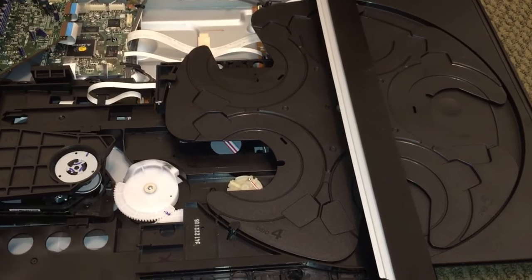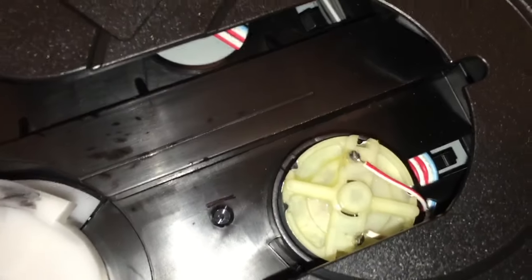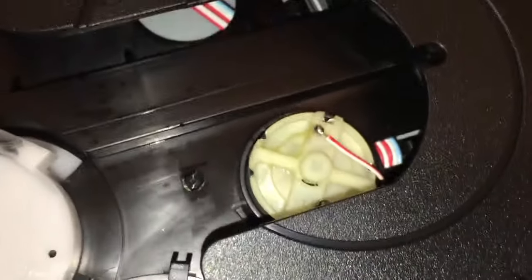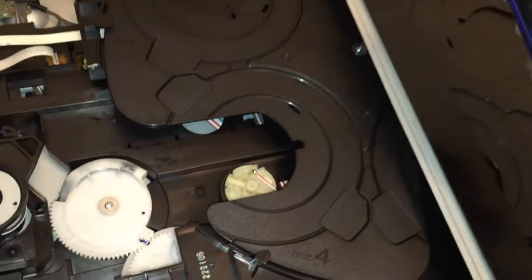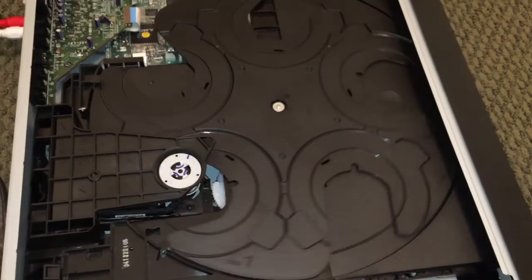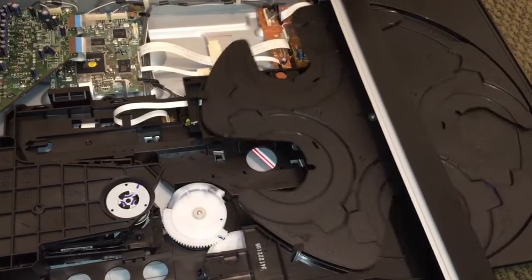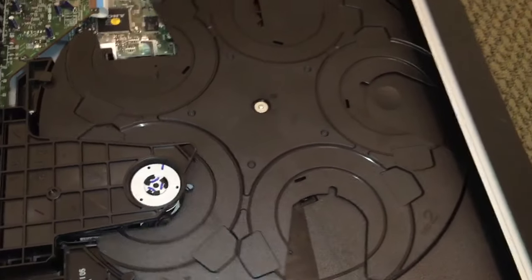After toying with this thing for about another hour, I discovered that our culprit is this motor right here — the one with the yellow top on it. You could tell it was struggling as you pressed the button. I actually just oiled it using this Supertech lubricant, which is kind of like WD-40 and is Walmart's brand. I took my little hose and very carefully sprayed inside both little holes right there. We did also replace the belt on the bottom. Now you can see she will move quite well on her own. Hit eject — boom! Comes right out.